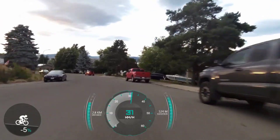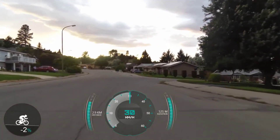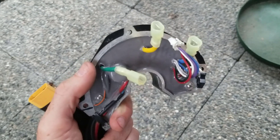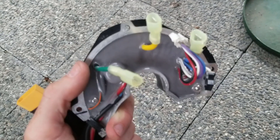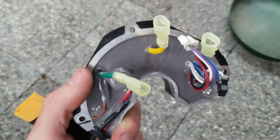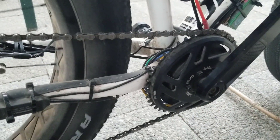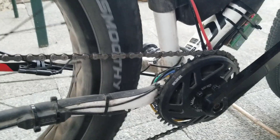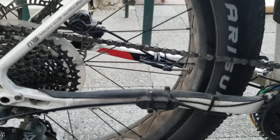There are also a few neat tricks to ensure the bike is not only fast but really smooth. The main one being motor engagement. The original Bafang controller, although perfectly functional, tended to lead to a jerky ride because it's very on-off in terms of how it works, either with the throttle or the pedal assist. When you're on the throttle or pedal, the power snaps the chain because the chain is slack when there's no power and tight when there is — so you get that snap. It made trail riding a little difficult at times, certainly on tighter trails.